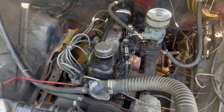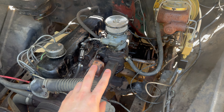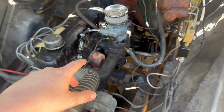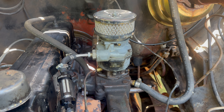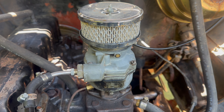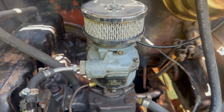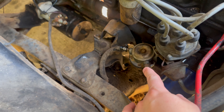The reason we're replacing all of these parts: starting with the intake and exhaust manifold, both are original to the truck and they are both cracked on the underside. Once we pull them out I'll show you. As for the carburetor — I believe this is a Rochester B or BV — I have rebuilt it once before and we are still having a lot of issues, so when replacing the intake manifold we decided to go ahead and replace the carburetor as well.